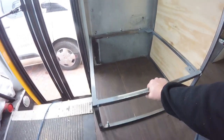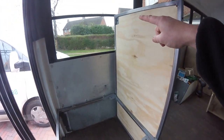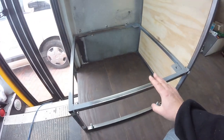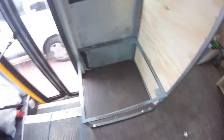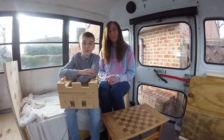I've temporarily got the frame bolted in and it's all solid. We've got the brackets for the seat belts welded in — one either side and one up the top, so we now have the three-point anchor legally required. The rail originally used for holding the seats has the bolts in, and then through the floor with a nice big washer underneath for support. This needs to be taken off again to be painted, but for now it's in place. Susie's cut a bit of wood nicely to go in the back, and now we can get on with the kitchen.